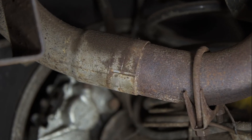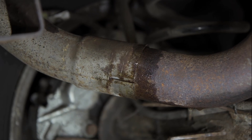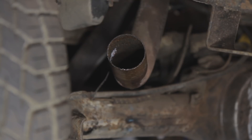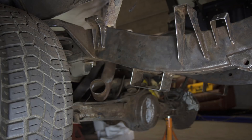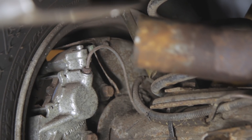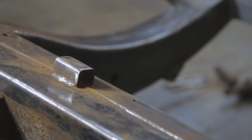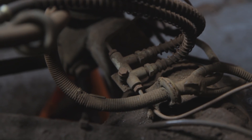I had tried to get the back box off before — I kind of gave up, but I went at it again. No problem this time. I kind of prized up the two flanges on the end of the back box section and with some lubrication and a lot of moving, this thing came off. The reason I did this was to get at the chassis leg on this side easier — I could only get so far behind it with the back box on. I cleaned the chassis and then turned my attention to the brakes, because I'm going to have to take the brake lines off this axle to do a proper job of cleaning it up. Up on top of the axle there's a kind of a brake junction point — and off that came.